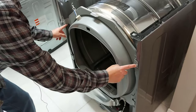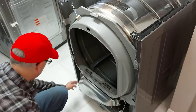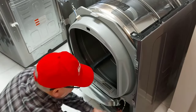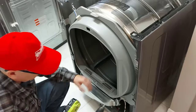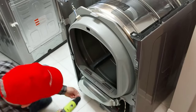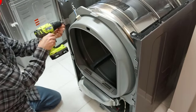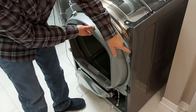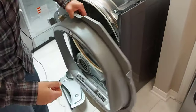Now you're going to want to remove this inner piece, which has four screws, and underneath there are three screws to the part that connects to the blower motor, plus this wire here. Press down on this connection and undo it. We'll grab the Ryobi gun again to back out the screws, then remove this inner panel by lifting it out through the wider slots.